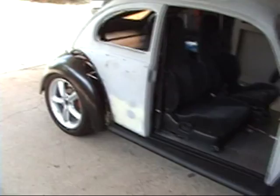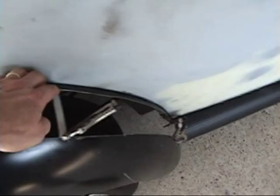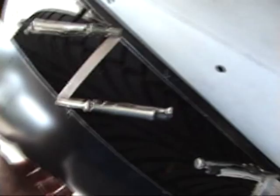I've started flaring the rear fenders as well as positioning and tacking on the front apron. I've started to put this one on — you can see I had cut it just a half an inch off the body here, so I made this fit nice and tight all the way around. I'm trying to line up the fender with it. I've got these little strips of steel here with little vice grip clamps on them. I'm waiting for a few more clamps to continue moving, but I've had to adjust it a bit. It fits pretty well. I drove it out of the garage and out here in the driveway and it didn't rub.